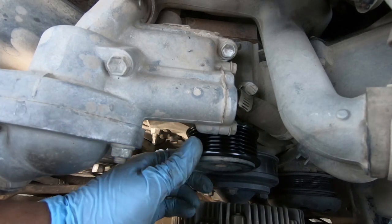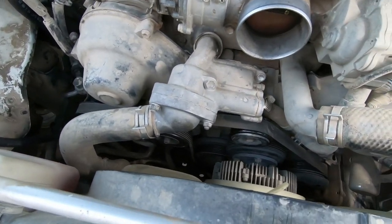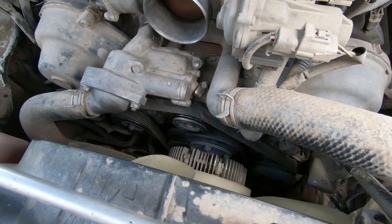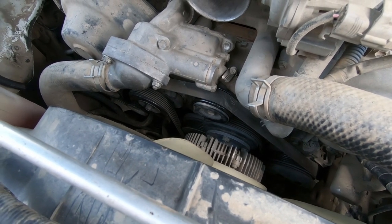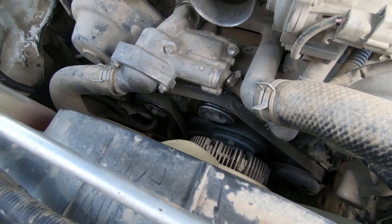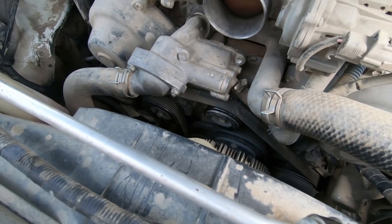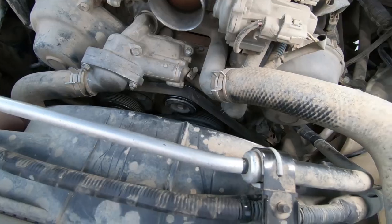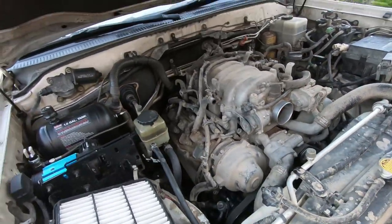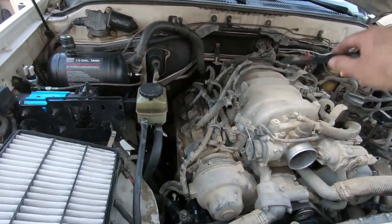There we go — brand new idler pulley. The belt is put back in place; it's still the old belt, I'll probably replace it eventually. Just like how you did to take it off, you torque down the tensioner pulley. Remember, it's reverse thread, so lefty-loosey is the right way to turn it. It'll come down a little bit and compress the spring, getting the belt on pretty easily. If the belt doesn't go on easily, that means one of the pulleys isn't sitting right, so make sure you double-check that before you try to start the car. And if you forget your pulley arrangement, the diagram under the hood should show you how the belt is supposed to be run along the pulleys. Now all you gotta do is put the cover back on, all this stuff — the vacuum hoses, engine cover — and we can start it.